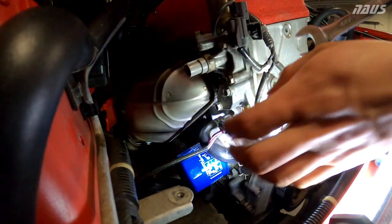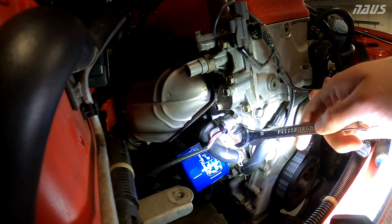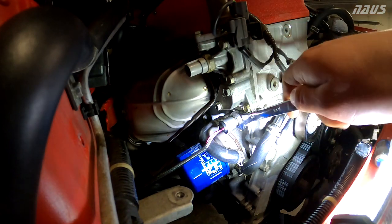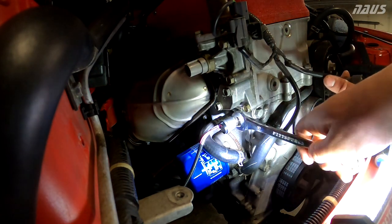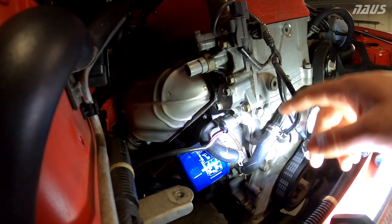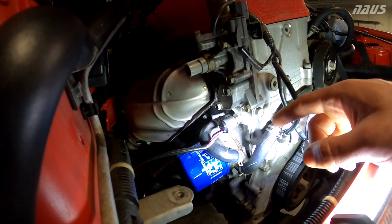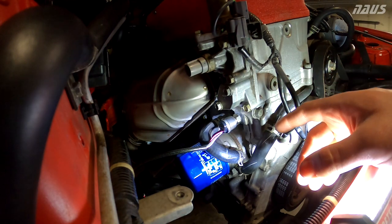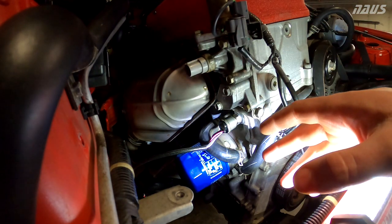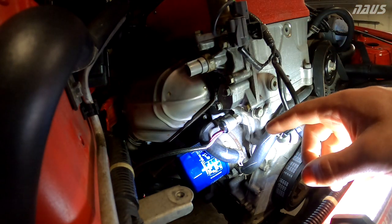This is a 17-millimeter wrench — much smaller than the 24mm used to remove the OEM. Before tightening with a wrench, check where your wires are exiting the sensor. I looked up a chart: this is a PT 1/8-inch by 28 thread count tapered thread with a 55-degree taper. The NPT equivalent calls for two to three turns past finger tight, so I'm going to take this just past two turns and call it done.